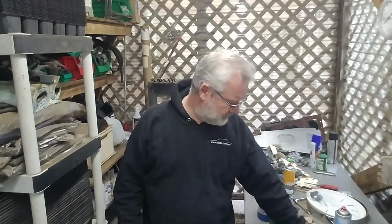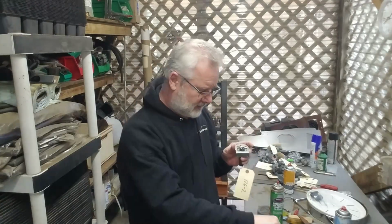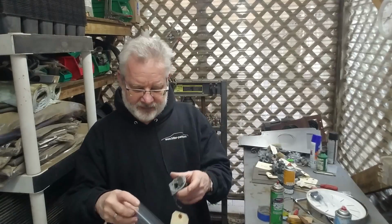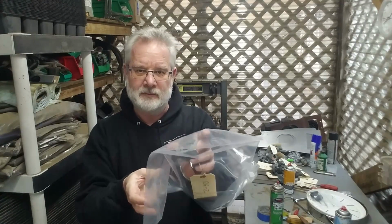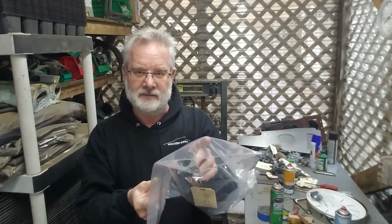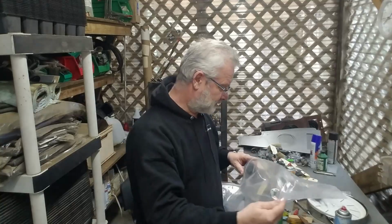So in conclusion, I was wondering what I have learned, and there are several things. The first thing is I will now clean the auxiliary air valve before I disassemble it, and when I have taken the cover off, from now on, after having seen parts fly off, I'm going to put the auxiliary air valve into a plastic bag and disassemble it in the bag. Then I know nothing can fly off and get lost. I mean, this would have been mildly catastrophic if I had lost the center pin here.